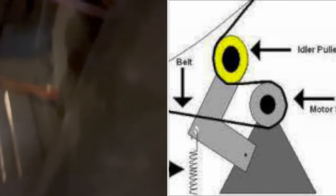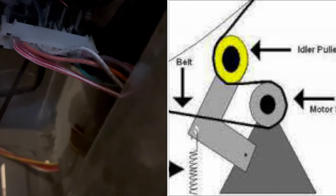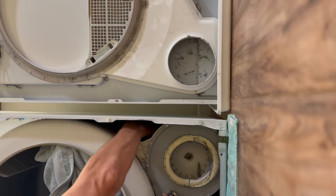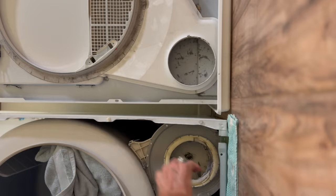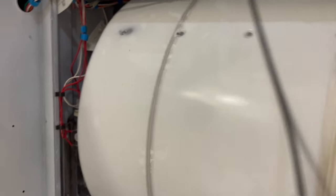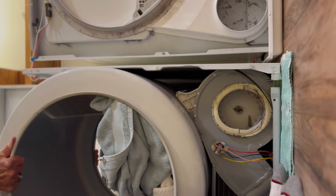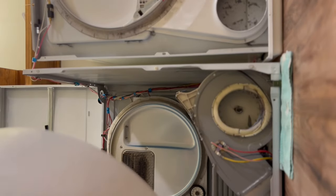The next thing I have to do is get the belt off, and that's going to allow me to pull the tumbler out. I'm reaching in here — you can see this big wheel over in the upper left-hand corner of the screen. I need to reach in on the right side and the left side, kind of like I'm hugging the machine, and disconnect that belt. Now I can lift up on the belt and get the whole tumbler to come out. I have to kind of lift up and pull out — that gives me really good access to the motor.